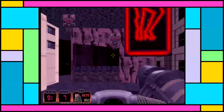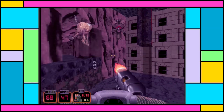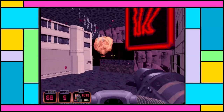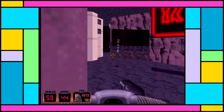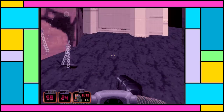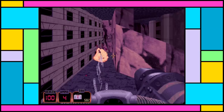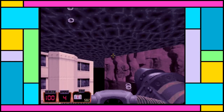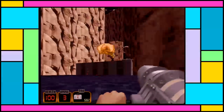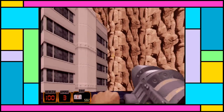Benchmark-wise, I'm not going to spend a lot of time on it. It keeps pace with the M520, which is quite impressive when you think that that board has pipeline burst cache and the later Intel Triton 2 chipset, and I have the timings quite tight. Plus, it was generally a very quick board, the M520. We're losing a hair because of the extra cache, but we'll ignore that. It's not really affecting anything real world. You can't see it. Otherwise, it did score identically, and it might even have edged ahead by a fraction in one or two tests.